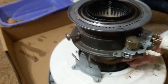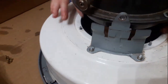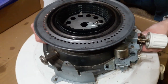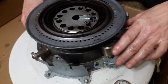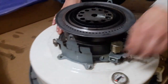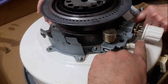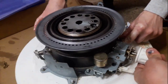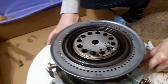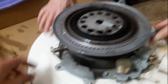We're going to need two people for this. You really need two people — one to pull down on the wick so it doesn't bunch up as you slide it down. We had a problem with it bunching up. Pull it apart again. Once you get it down, just test it and make sure the wick goes up and down good. It seems to be working pretty freely. That first time we got it on there it bunched up, but it's okay now. Then we're just going to put our wing nuts on.